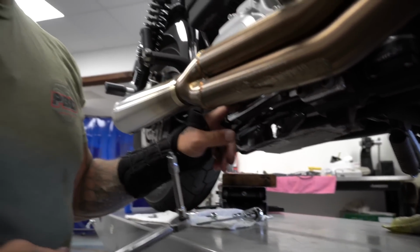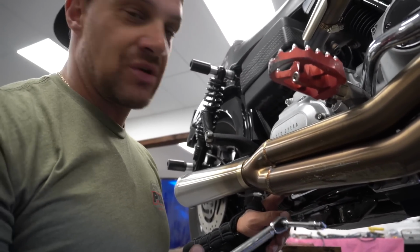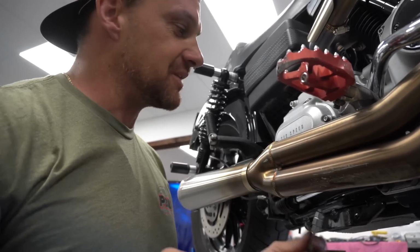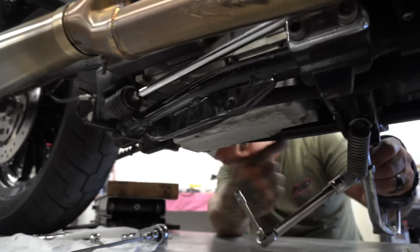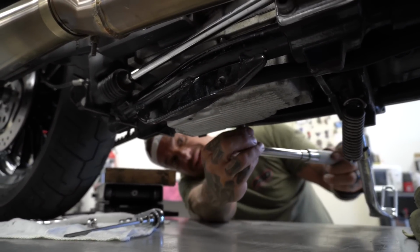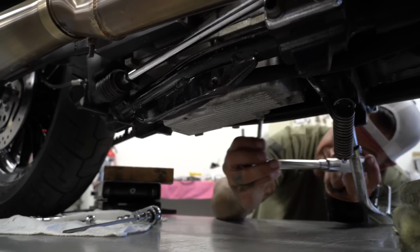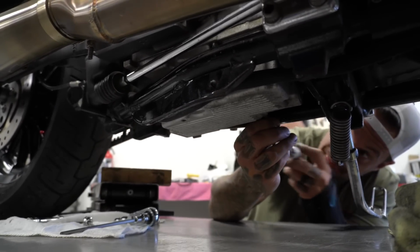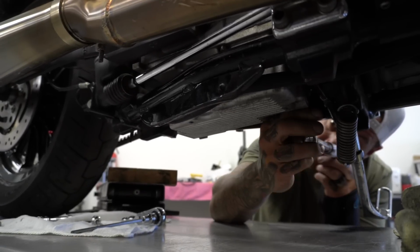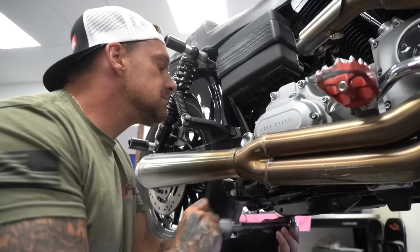Well, except for this one. We're leaving this one out till the last very moment. Once everything is torqued, the gasket's compressed as much as possible, and then we're just gonna put her in with our fingers. I'm gonna start at this corner right here, and I'm gonna go all the way back around just to make sure that they're all torqued. I didn't miss anything. It just ensures myself in knowing that I'm not gonna have a leak down the road. And it's not gonna over torque or change the torque on anything because they're already torqued.